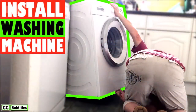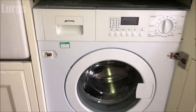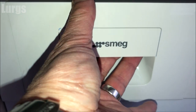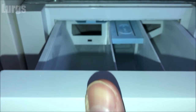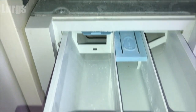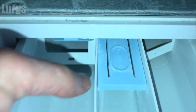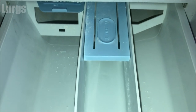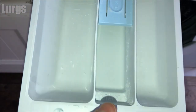Before we get started, there's a link above about how to install a new washing machine. This is the Smeg washing machine — it's an integrated washing machine, so the dispenser drawer is on the top left-hand corner. Just pull it out until it reaches a point where it won't go any further, then push the blue button down, which releases the clip and releases the dispenser slash detergent drawer.